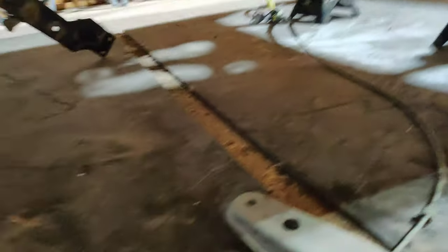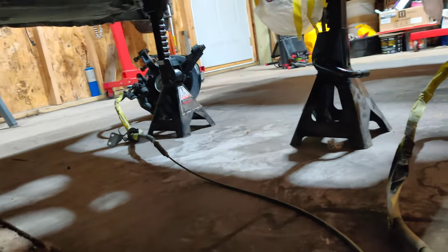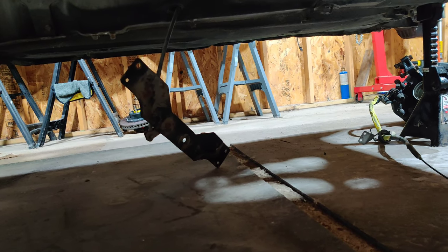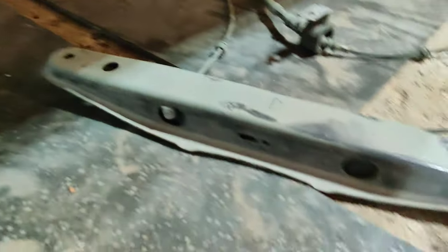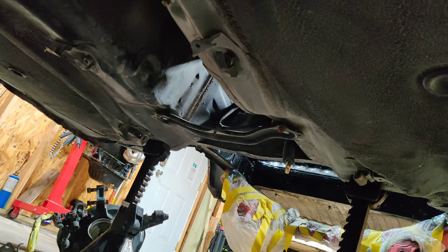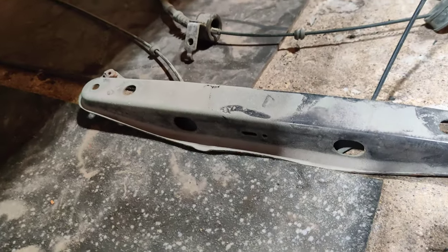I just removed all the mechanisms that help with the brake lines — routing them and positioning them. That one there is for the e-brake. It also helps position and route these brake lines: these are for the right and left rear. This one holds and routes the front brake lines along with the e-brake and rear brake lines. So both of them are off — nice and clean, nothing in my way. There's a bracket right back there that holds the tank — I think I'm going to remove that and get it powder coated as well. Then we'll start the sanding.